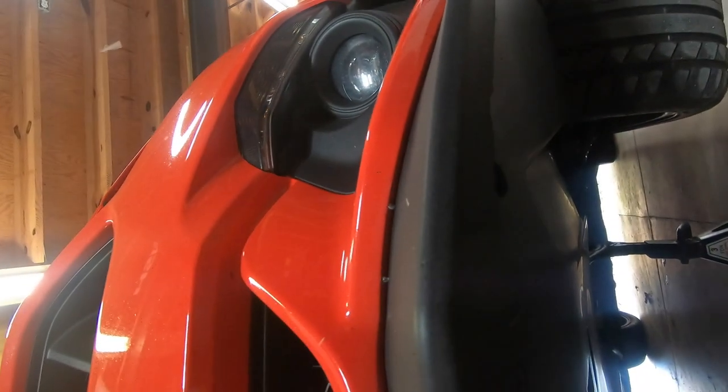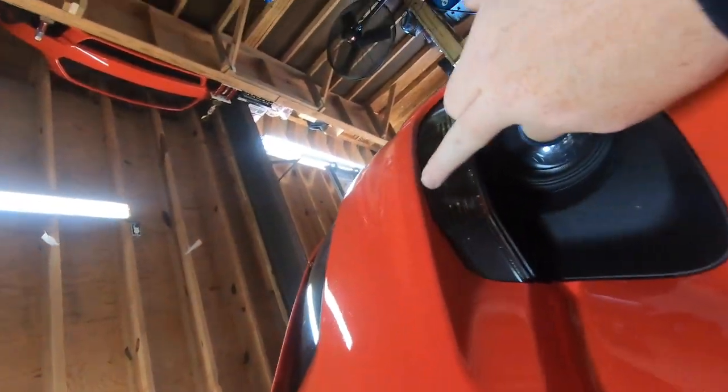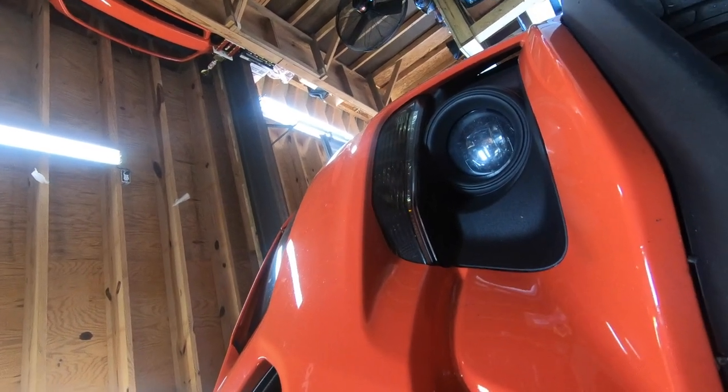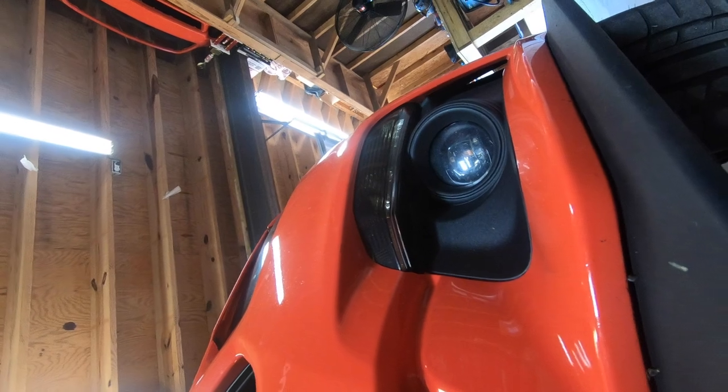Here we are — this whole pan here is the belly pan. We're going to go ahead and zip all this off. There are screws all along here — about 30 of them — and then a few plastic clips. This whole belly panel comes off, and I'm hoping that's enough to get up in here. This is what we're taking out right here, and that whole piece gets replaced with the OPT-7 sequencing unit.